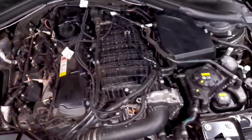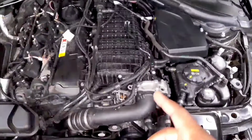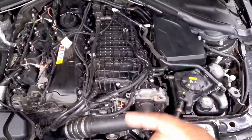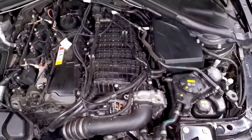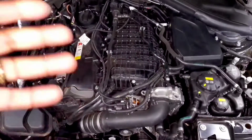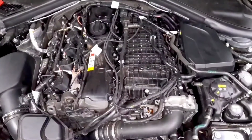Especially in our case, it's before the intercooler, so there's some pressure drop potentially, and the electronic throttle movement can actually create a difference in pressure that you see before and after the throttle body. So focus on the actual manifold pressure, but I usually put both in my log just so I can see what's happening both before and after.